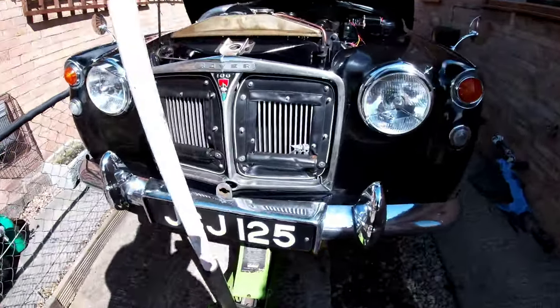If you're getting battery voltage there, that means your relay is okay, the fuse is okay, and most of the wiring is okay. If you're not getting a click from the relay itself, then you've got other problems which I won't go into at the moment because I didn't have these problems. I just hope this video is going to help you understand how this works.